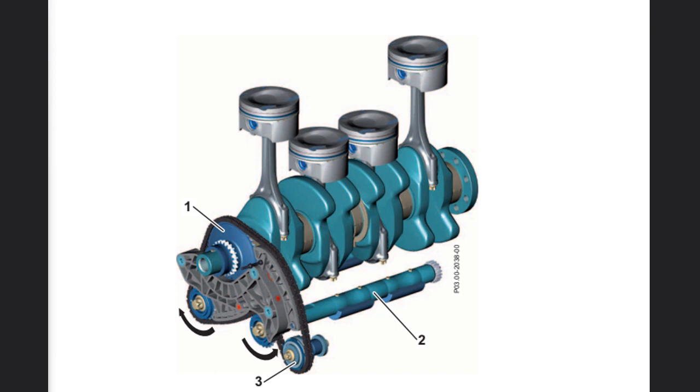With the new Lanchester balancer it has been possible to achieve a considerable reduction in disturbing vibrations caused by piston movements, providing comfortable smooth running. The Lanchester balancer operates with two contra-rotating balance shafts, each mounted in three bearings in a one-piece die-cast aluminum housing. These tubular steel shafts are inserted into the bearing channel of the housing and are then bolted to the imbalance mass segments. The faces of the imbalance mass segments also act as locators and axial bearings for the shafts in the housing. The housing in which the balance shafts are mounted is located inside the oil pan and is bolted to the crankcase from underneath. This housing also acts as a ladder-type frame which serves as a stiffening bridge for the bearing seats and thus improves the cross-bracing of the crankcase.